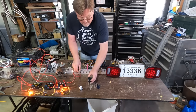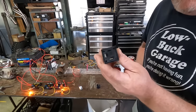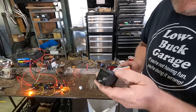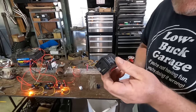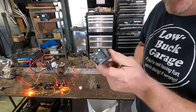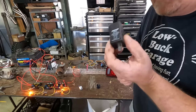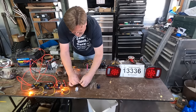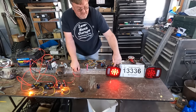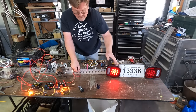I bought an EP50 — it's the same two-prong style, same connections, but it's LED compatible with an electronic rather than mechanical flasher, rated for one to twenty bulbs. I figured this would handle anything I had. But it doesn't work either. Going to the same test rig — it does something slightly different: it gets bright and then gets dimmer, as though it's trying to flash but can't quite do it. So I was sort of disappointed that didn't work.